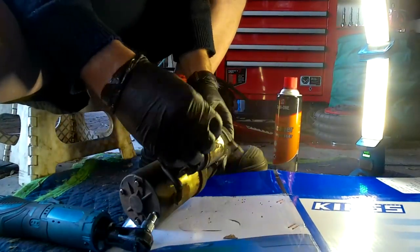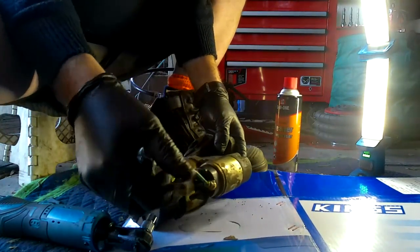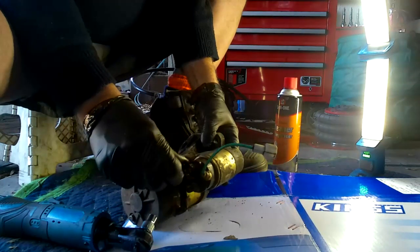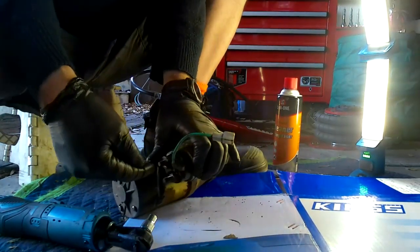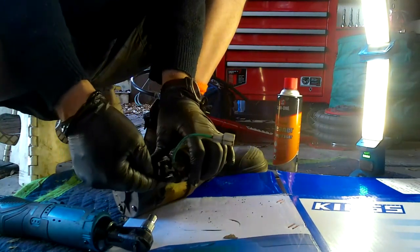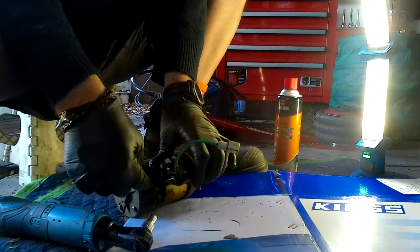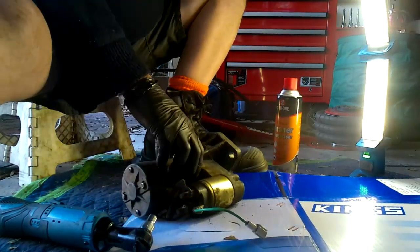Now you can see, this is your ignition wire. When you turn your key, this energizes this solenoid. The solenoid then moves backwards, and then the contact disc connects to these. Yeah, so your power comes in here. This is your starter motor power. So the power's in here. You short them out by the contact disc inside. It then powers your starter motor. That's how it works. Okay. Just as long as you're aware of how it works.